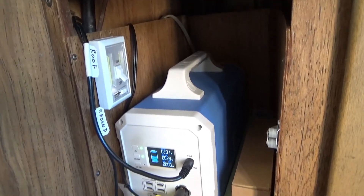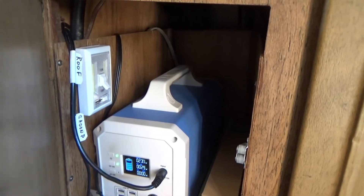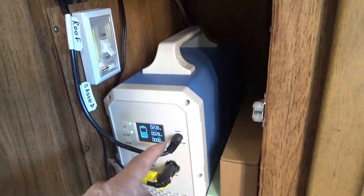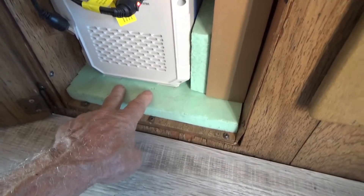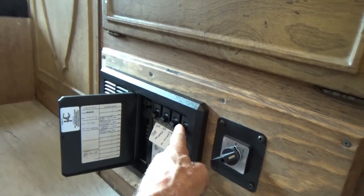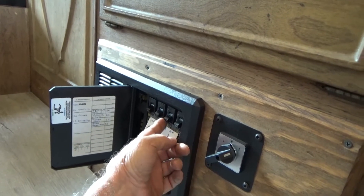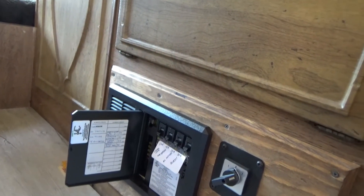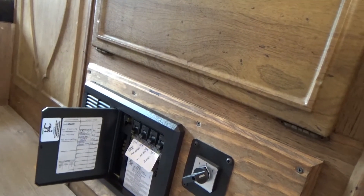This is kind of soft-wired, if you will, to the motorhome. In other words, I can have this out and in another vehicle in about one minute. It's not bolted down, doesn't need to be — it's on a foam insulating thing to absorb vibration, doesn't slap back and forth. That gray cord right there is an AC line which goes over to that breaker. So when I'm in the boonies, flip this up and the AC outlets flip that up, and these will be powered — 120-volt sine wave.